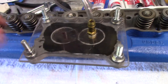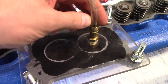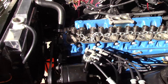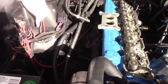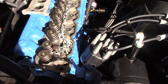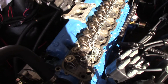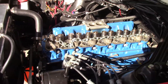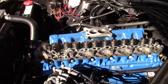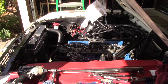This is a quick thing you can do — I made it out of quarter-inch plexi with a brass fitting tapped quarter-inch NPT. I got ahead of myself without videoing it but there's not a lot of magic here. We've got the manifold off to the side. We got all the studs out — you want to make sure if you've got studs you take them all out, don't leave any of them in there trying to pull the head off, it's just a headache. When we put it back in we'll do the four corners. I'm just going to bring the hoist in — I've hucked it in and out of here so many times, I learned to just use the hoist now. I'll cherry-pick it right out.